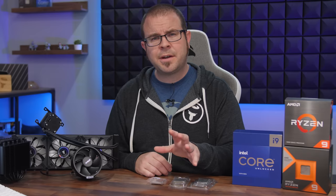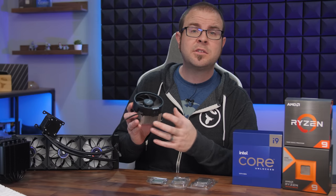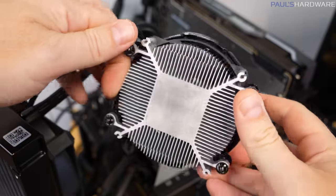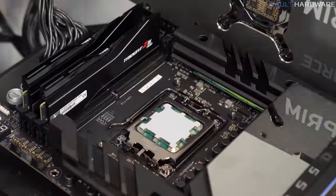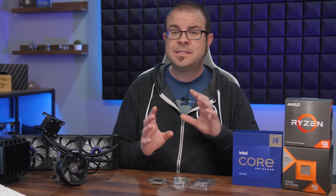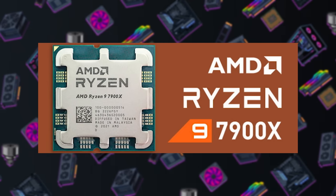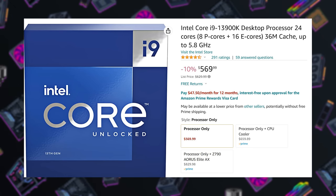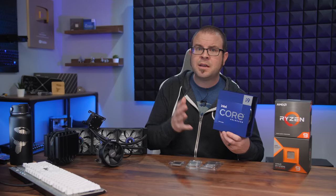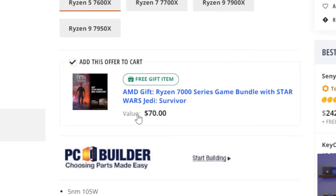That's not quite all for item number one, the CPU — there's also the CPU cooler. For budget builds and beginners it will often come packaged with the CPU, also known as a stock heatsink fan, which is totally fine and adequate for getting started. Just make sure your CPU actually does come with a stock heatsink fan if you're parting out your own build. It's actually the higher-end CPUs that often don't come with a stock cooler — the ones unlocked for overclocking, usually ending with X for AMD like the 7900X, or K for Intel like the 13900K — because they figure if you're going for that kind of CPU, you'd probably want a better cooler anyway. It should be listed on the product page whether the CPU does come with a stock heatsink fan, or crucially, if it does not.